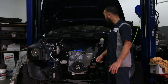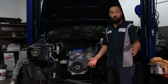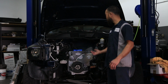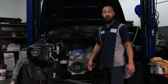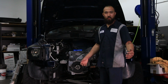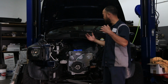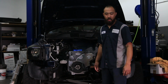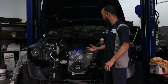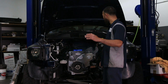Piston wise, I went with Industrial Bull, Marine, QSB, whatever you want to call them, stock bore pistons. Made by Interstate McBee, so whether I got OEM Cummins or not, whatever. I had the second rings cut by Total Seal, so the second ring, the compression ring, is gapless. What else did I do?